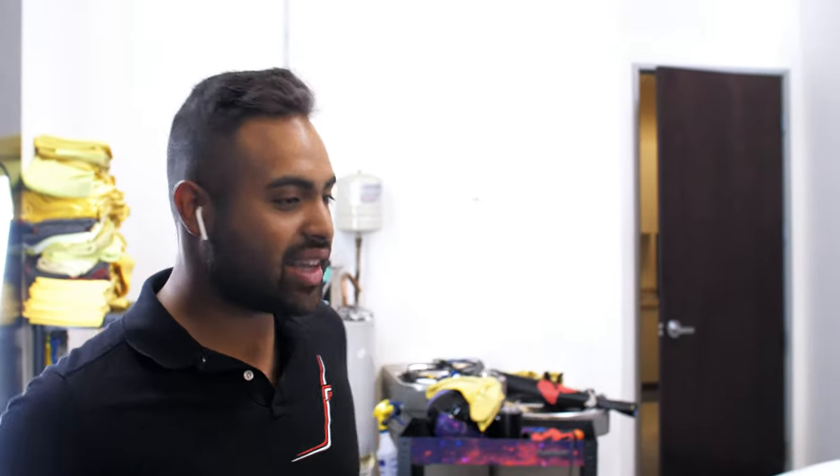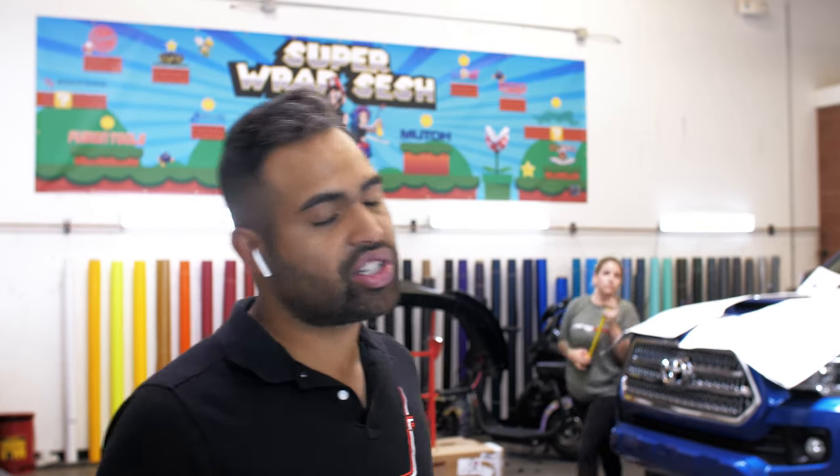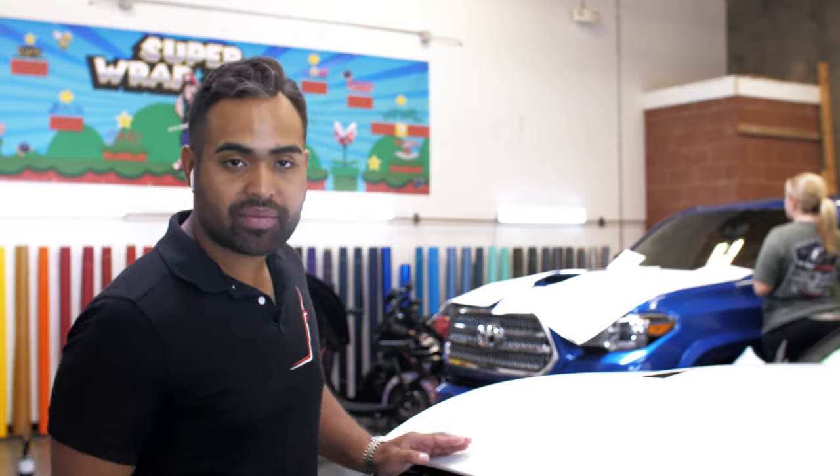He's going to take the car and right down the center of this car, we're going to do half Ceramic Pro and half uncoated. Basically, we're just going to show the effects of what Ceramic Pro is going to do to this wrap over about a one-year period. To already predict what's going to happen — this side is going to start to yellow out. Phoenix gets extremely hot here; it's a dry heat, so we're looking at temperatures up to 120 degrees. The surface area of this car is probably going to get an easy 180. What we experienced last time — we had a chrome wrap on this and the chrome actually burned onto the paint, started turning these really weird colors, and when we took it off it was extremely hard to pull off. So we're going to show how easy it is to clean this vinyl, how easy it is to take off after a year-long period, and more importantly when we go out to the racetrack, we're going to show how unbelievably easy it is to clean up the side of the car when that rubber gets kicked up from those R888 and Pirelli tires.